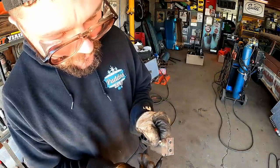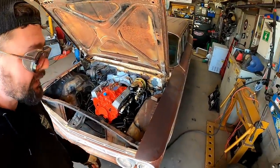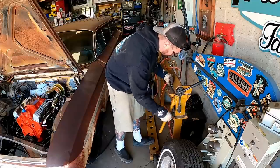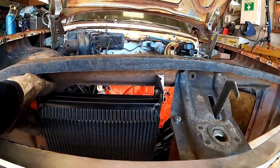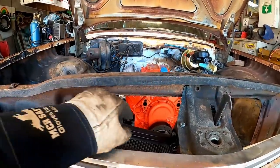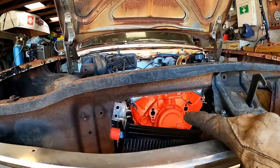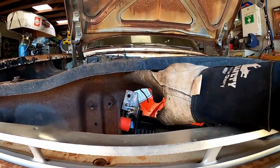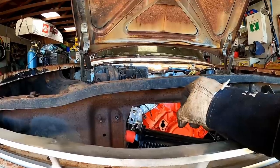Flatten our smaller one out. We're gonna move our brake further this way. Eagle Eye didn't calculate enough offset to kind of straighten that thing up like we need. This should get us closer. Yeah, that's a little better. This is slanting back that away, so that's why those need offset, where it's actually sitting in here straight. Kind of hard to show, but basically I'm about to sand that down to some bare metal, and then we're gonna spot weld it through the top hole.